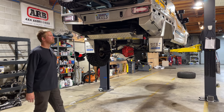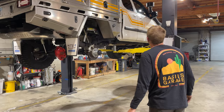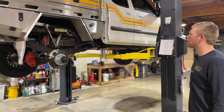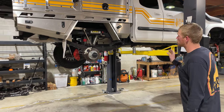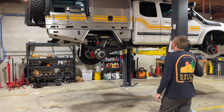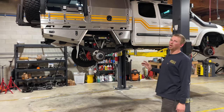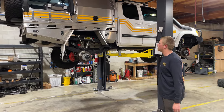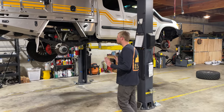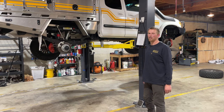This axle is pretty much bulletproof — the whole purpose of this truck is everything's overkill, everything's excessive, we don't want to break anything in the middle of anywhere. The entire frame has been gusseted and boxed in. We stripped the tray and canopy off the back, cleaned the entire frame, got rid of any rust, and then boxed the whole frame in with 3/16-inch steel plate. After it was boxed in we painted the inside with an internal frame coating to prevent future rust problems. It's a fully boxed frame now.